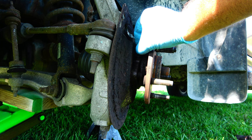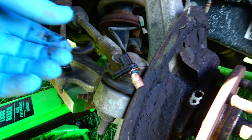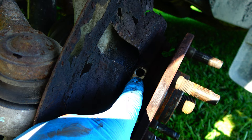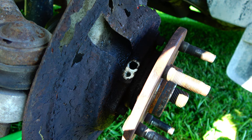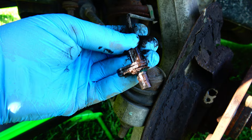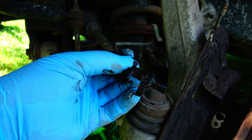Just kind of wiggle that thing until it comes loose. I don't see anything obvious with it, and the tone wheel looks like it's in good shape from what little I can see of it. It may have just gone bad — I'm hoping that's the problem. So I'm going to get a new one, pull this one off, put a new one on, run diagnostics and see if that fixed it. These are pretty inexpensive, so it's not a big deal even if that wasn't the actual cause, but I believe it is.